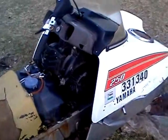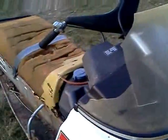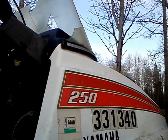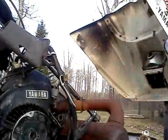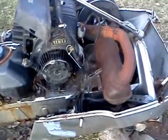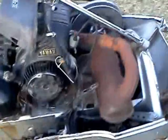The recoil was jamming up, so I took it apart and cleaned it. While I was putting it back on, I noticed some water leaking. You can see that right there — that rusty gunk of water coming from the exhaust. So in other words, I have water in my motor. I'm not really surprised. Got to get that drained out, and I'll keep you posted.